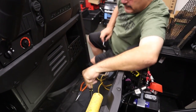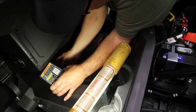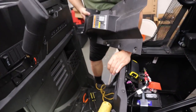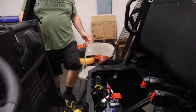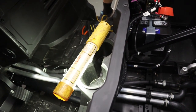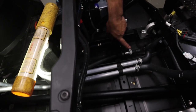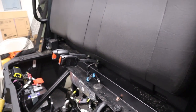We got all the pins out — there are four on each side. The floorboard just pops out towards the driver's side and now we have full access. That's basically everything we have to take apart. Then we're going to go ahead and feed the wiring harness all along the main wiring harness of the unit, zip tie it, go all the way to the back.